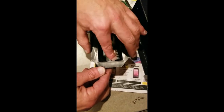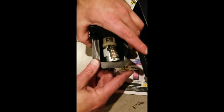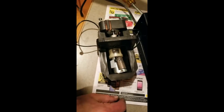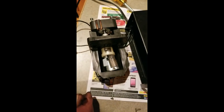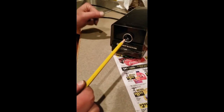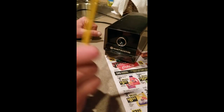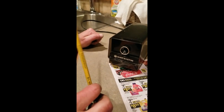Make sure this shaft is in the hole on the back end where the actual sharpener part is — it goes into this hole and should fit nice and snug. Put these two screws back in and the rest of the cover. After you put your cover back on, plug it in. Thanks for watching, take care!